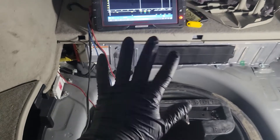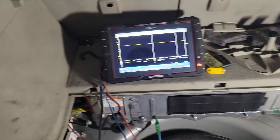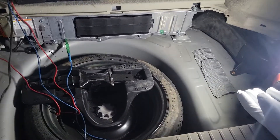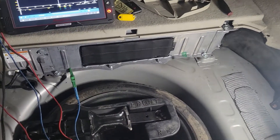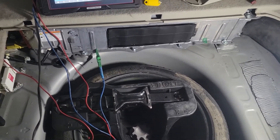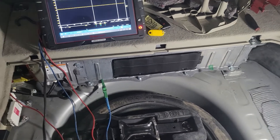If you're working on hybrids, you want to use a one-handed method and make sure you have a mat so you're not contacting the ground — though tires are usually good insulation. What you don't want is to be working on one side and then touch the car with your other hand, because now you've just shocked yourself. DC voltage is not something where you get shocked and you're done — it's going to try to kill you. It'll run through your heart, especially if current passes from one hand to the other, completing a circuit right through your heart and stopping it.